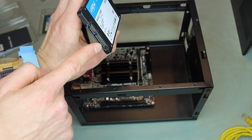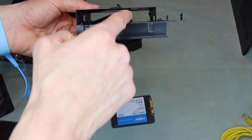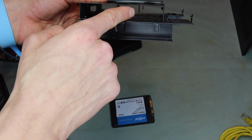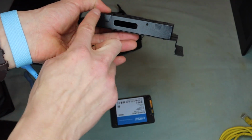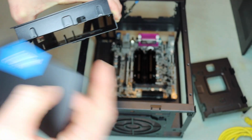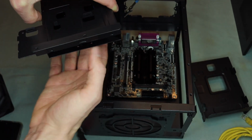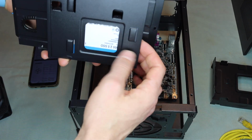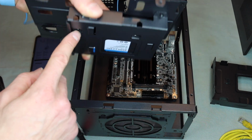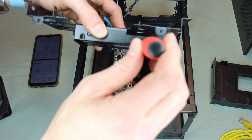Now it's time for the SSD, and the 2.5 inch has some guide rails inside it that will help you align the SSD. There's also some screw holes. Some are inset, and it slides right in there and lines up with those screw holes. There are screw holes already in the SSD as well. Here's another angle for it, and again, those screws might be inset or they might be right up against the surface on the opposite side of this 2.5-inch SSD casing. So screw it in.